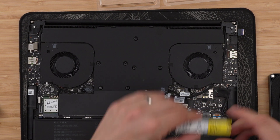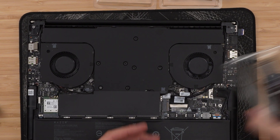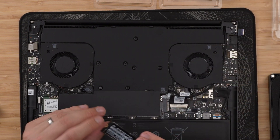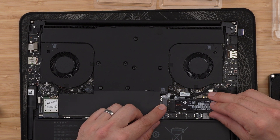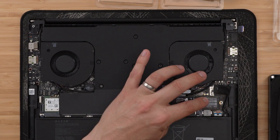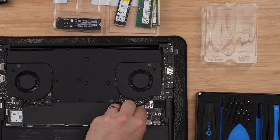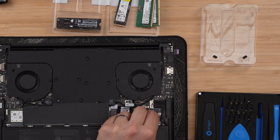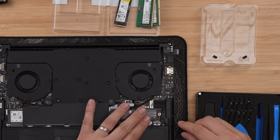You will notice there are a few chips at the base of the motherboard underneath this SSD, so we do need to be a bit careful - you don't want your SSD to touch any of those components. What they've installed with the drive that comes with it is a couple of little foam pads because it is a single-sided SSD in this motherboard. But the SN850X we are using is a double-sided SSD. There's not a lot of chips on the back, but it's enough to stop it seating nicely when you screw it down. It actually bends the SSD if you leave those foam pads in place - that puts undue stress on the SSD. So I removed those two foam pads and I've used a very thin half a millimeter thermal pad on top of the chip so there's no way the SSD and the motherboard come into contact. Now the SSD sits in beautifully in place in this connector.